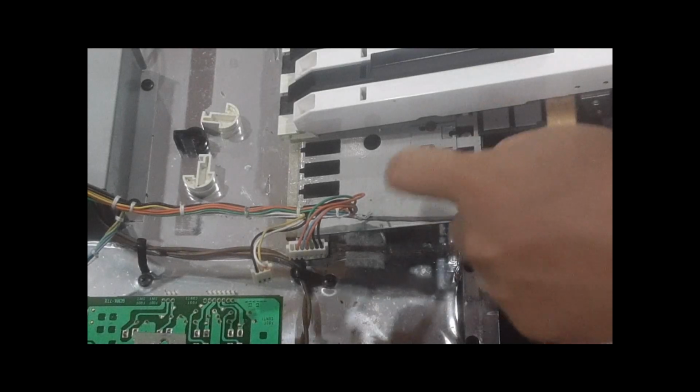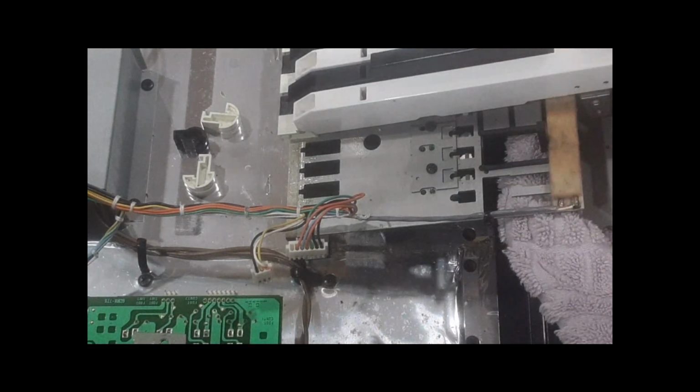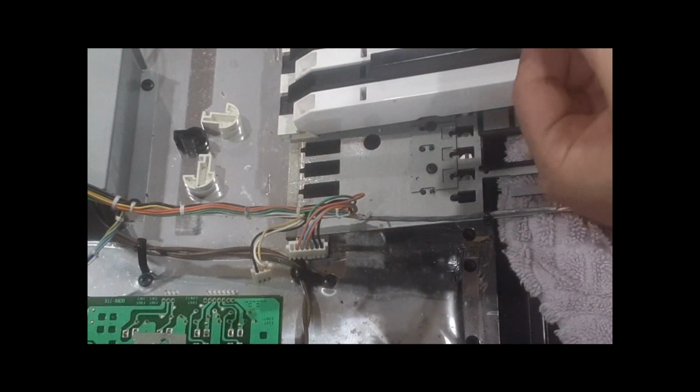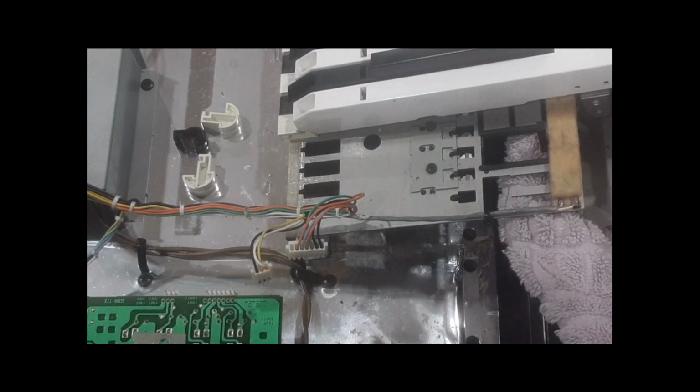What we have here is just a metal frame, but in here, I'm going to very barely touch them. These are the switches that control how the KX88, and very similar switches on the DX7, work. When you push a key, this little piece right here, just next to the spring, pushes down on that switch. And the switch has 2 contacts.